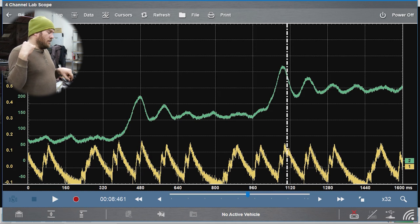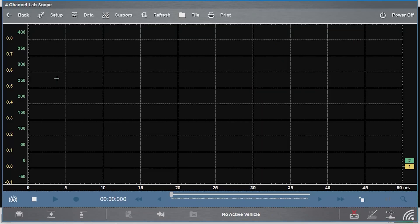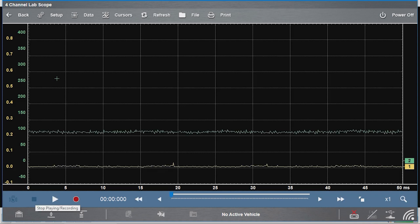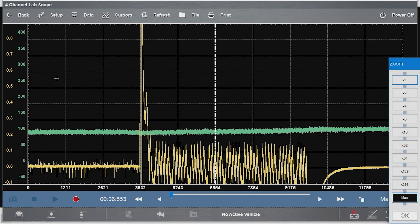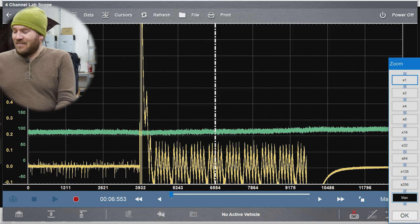Now I can get to cylinder number four pretty easily. So if I pull cylinder number four's spark plug and crank it over, there's going to be no compression in that hole. If I don't see a spike going into the radiator, then I've identified the cylinder. Cylinder number four — I do not see any antifreeze on the plug. Let's go ahead and crank it over and see if I still have a pressure pulse. If we do, then it's definitely cylinder number five — I was just on the fence because it was kind of in between the two cylinders. Must be cylinder number four, because we do not have pressure pulses going into the radiator now. That pretty much confirms it — we have an issue with cylinder number four.